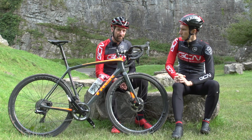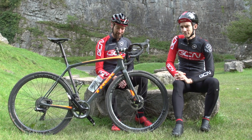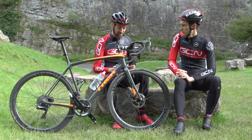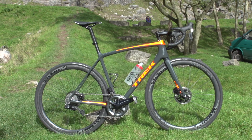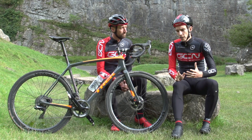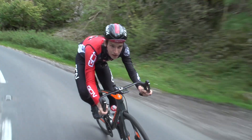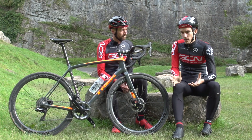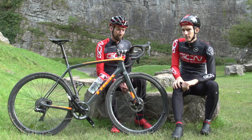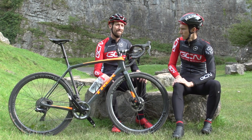Before our experiment, we consulted with bike design guru Tom Sturdy, who has already done quite a lot of experimenting himself. What he found is that you're probably not going to find much of a difference between a long bike with a short stem versus a shorter bike with a long stem. But that choice is very important for shorter riders due to the limit of wheel sizes — if you are a shorter rider, you really want to go for a longer frame with a shorter stem. In order to offset that twitchiness, you'd then hope that the actual geometry of the bike — the DNA of it — would mean it had more built-in stability. Although stem length doesn't have a huge effect on the way it rides, in order to feel the bike as it was designed to be felt, you should probably use it with the stem length it was specced with, as the designer intended. You can rest assured that there is a good reason why bike geometry has remained pretty much the same for decades.